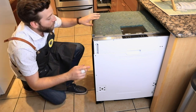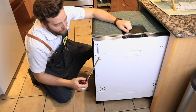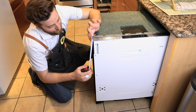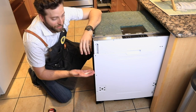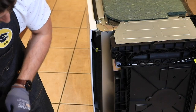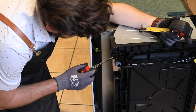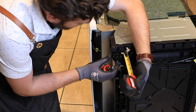What we want to do is take our measuring tape and measure the height between the bottom of the counter and the top of the dishwasher. That way we can take that measurement to the bottom of the feet, and that will be a nice baseline to get this ready to fit in. The height needed was two and a quarter inches. It's pretty easy — just get your screwdriver to loosen up and apply a little bit of pressure there to adjust the feet.